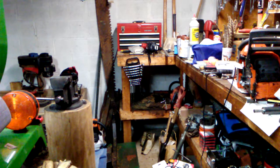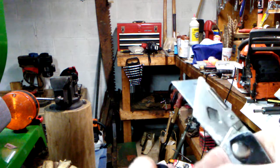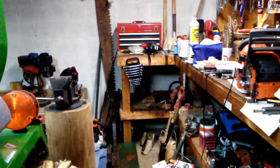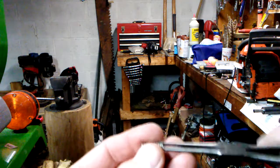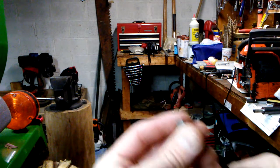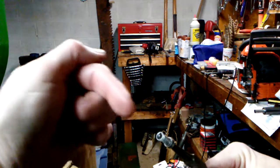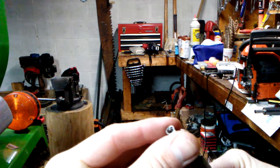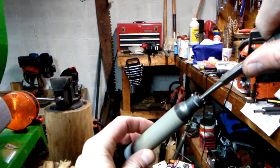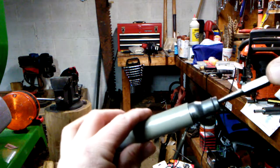So we'll install the spring — that's probably the most difficult part of this whole process is getting the spring in. It's taped to the boot. To put this in, take your tiny needle nose pliers — I have done this with a 3mm Allen wrench as well. What you want to do is hold the little tab that runs across the spring at the bottom, and push that lower end of the spring into the bottom of the coil pack, right like this. Twist it just a little as you go in, then release.